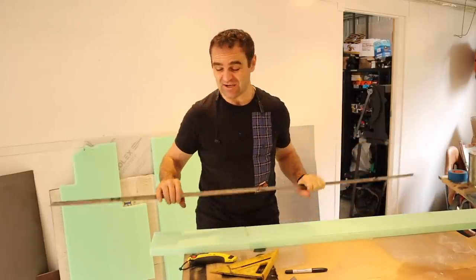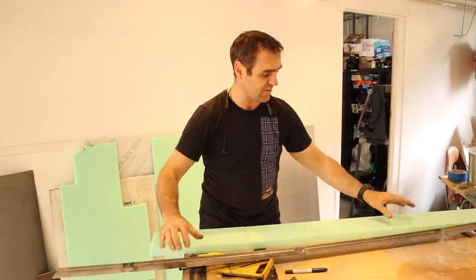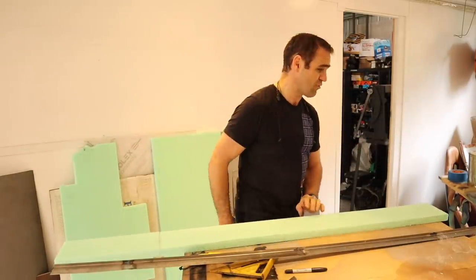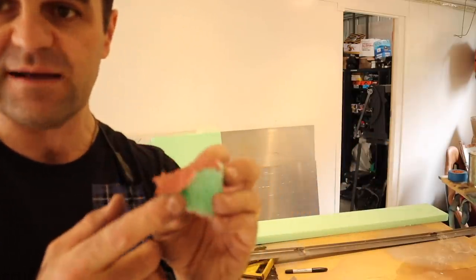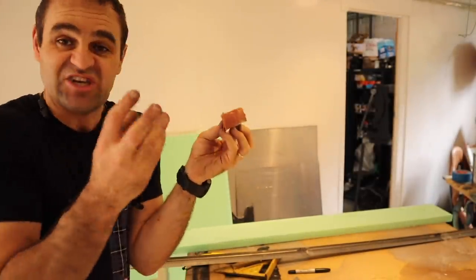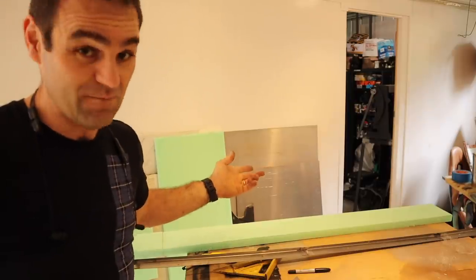After that fail, I'm doubling down and going again. I've extended my bracing and I'm putting it back in the car. I've started with another bit of foam hot glued to the table to get my length, and we're going to start trimming again. I did a practice with the fiber body filler — this has been sitting for 20 minutes and it's already getting harder. It'll give that extra strength I'm after and still hold its shape, so it's not going to disintegrate like the fiberglass did. I think this is a better option.